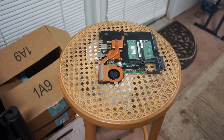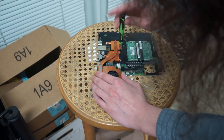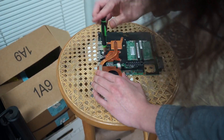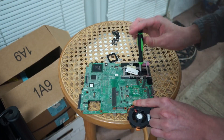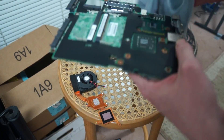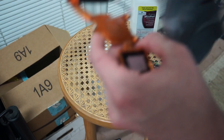With these — I don't know if they're new old stock or where they came from — you do actually have to do a few things. The thermal paste still dries out even if the computer wasn't really being used. I just go in and unscrew the heat sink, though I'm a little bit OCD about the actual thermal paste application. You also have to remove some stickers and plastics. There's one screw on the other side to remove the heat sink — take that off, get some isopropyl alcohol and some microfiber cloth, wipe off the thermal paste on the heat sink and on the motherboard.